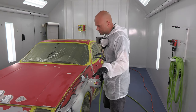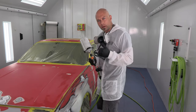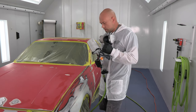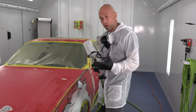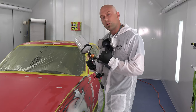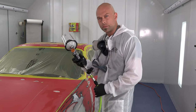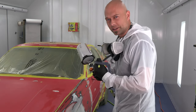We're all wiped down and taped up, ready to go. I'm going to do two coats of polyester primer. This is Evercoat Super Build — it's a four-to-one primer, polyester base, great product. I'm using my Iwata Air Gunza, 1.8 tip, spraying right around 28 to 30 PSI. So I'm going to do two coats over my bodywork and show you guys what that looks like.